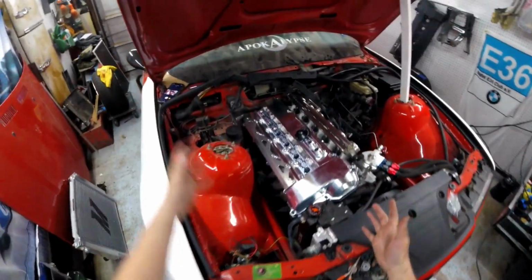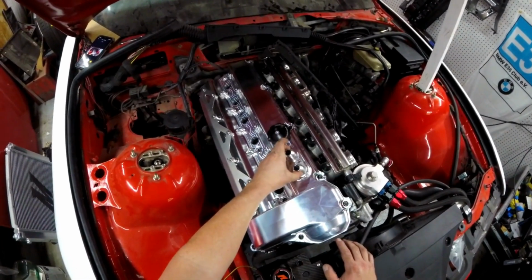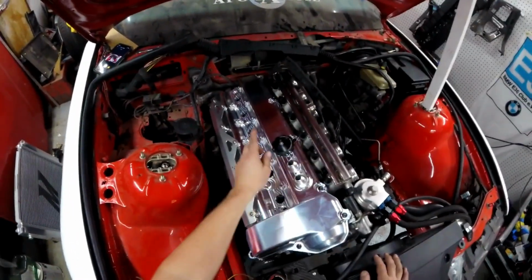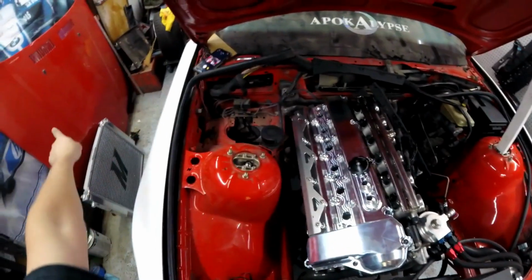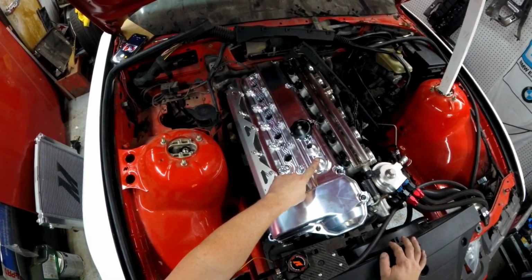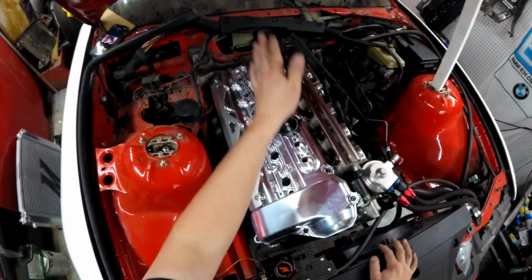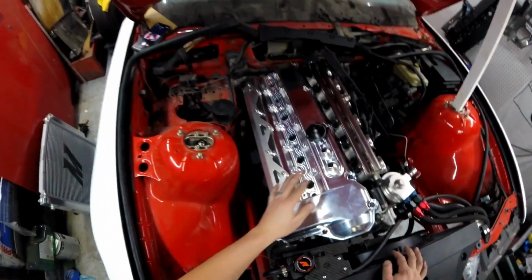It's gonna look amazing. We are gonna run a catch can. That's what we're gonna look at once we bolt this down. We are gonna take these lines and see what kind of catch can setup we're gonna set up over here. But I have some spare lines in a box, so we're gonna see. I can't remember. These bungs are 12 AN, and I believe what I have in there is 10, but it might be 12. I'm not sure. But we will see if they are 12. Then we'll get them all kind of set up and see what we got, so we see what we got to order versus what we already have, so I can make the right choice. And then get this thing bolted down.